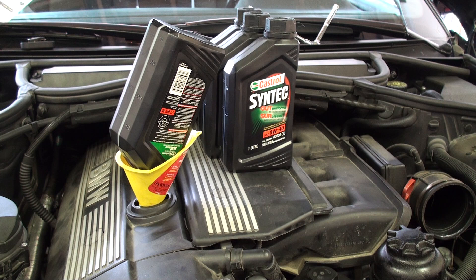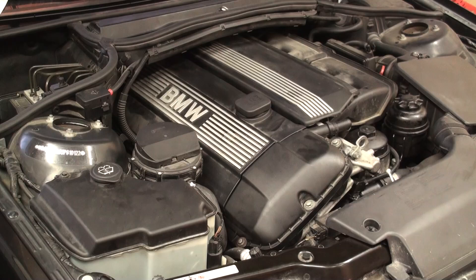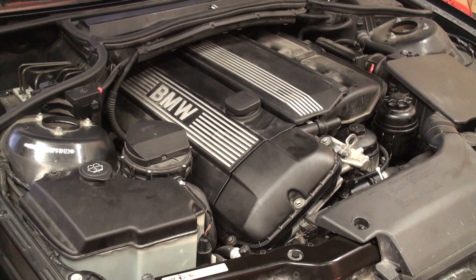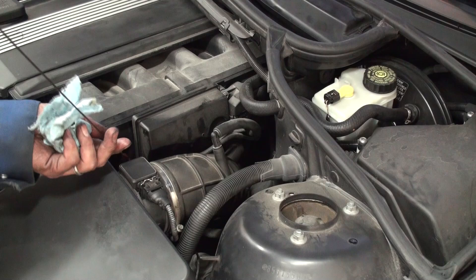Once you've installed approximately 7.5 litres of engine oil into the motor, start the engine and look at the top side, underside, and around the filter to see if there are any oil leaks. If there is the slightest leak, shut the engine off immediately and retrace your steps. If there are no leaks, proceed to reinstall the lower frontal and rearward engine splash covers using a Phillips screwdriver and the original screws. Once the vehicle has been running for a few minutes, check the engine oil level on a flat, level surface — the level should be at the very top. If it's slightly low, add a small amount of engine oil until the proper level is attained.